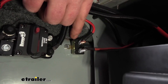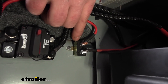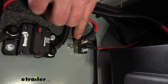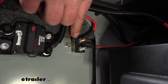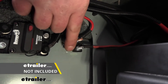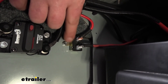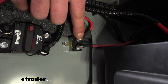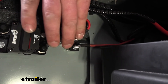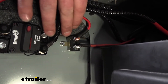In our case, our breaker is mounted in a compartment where it stays dry and out of the elements. But if yours is mounted outside, the weather isn't going to damage it — though after years of use it will start to show some wear. You can pick up separately a rubber cover that goes over the breaker and over the contacts to help keep everything off of it. It can also prevent you from accidentally tripping the breaker if it's in a high-traffic area.